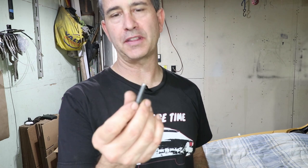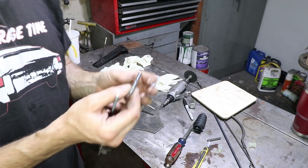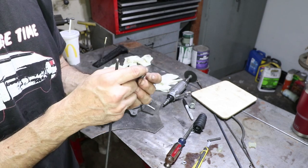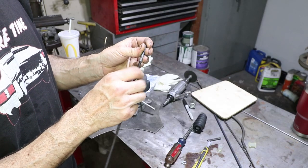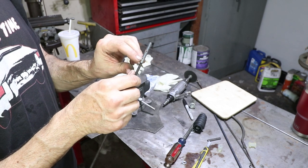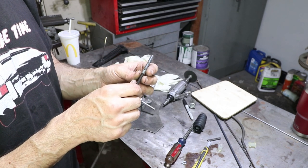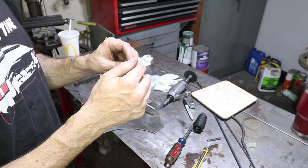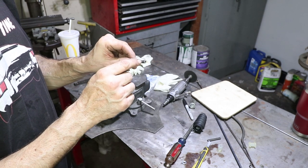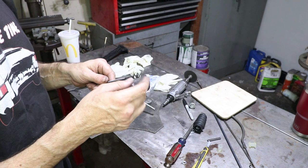I had a little diversion to the workshop to make these couplers. This is a little different than what I expected to do, but I think this is better. Here's the game plan: I drilled a hole through the entire part and threaded one end, so this threaded rod is going to go deep into here. Then I ground a little moon out of it so I can attach this permanently with the welder — I'll just fill this up with weld; it'll melt these two pieces together far from the end. On this side I'm going to put the smooth rod, hammer it in, and then weld it in two areas far from the end. That way the weld isn't going to fatigue the metal or cause it to crack.